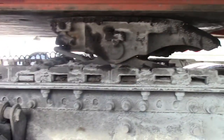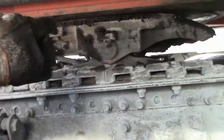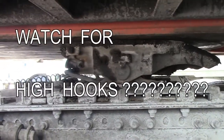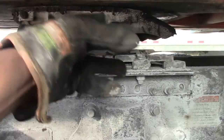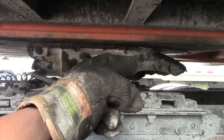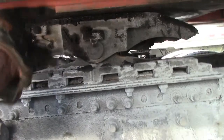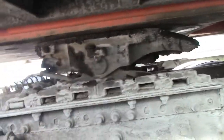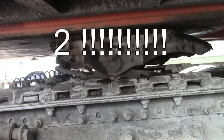Sometimes you have space because somebody who dropped the trailer before you, they probably dropped it kind of high. Your fifth wheel got it, but they got a real good snug on it, so it'll be like a little space right there. Or sometimes you'll have what you call a high hook. That means the fifth wheel hit the bottom of the kingpin, but it wasn't enough to grab it. It'll make this go in like it's hooked to it. It's really not. It's actually sitting on top of the fifth wheel locking jaws. So you gotta be careful with that. So we got a solution for that.